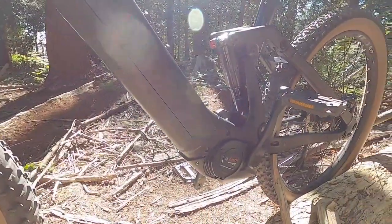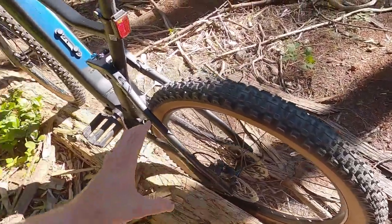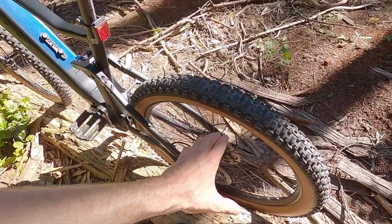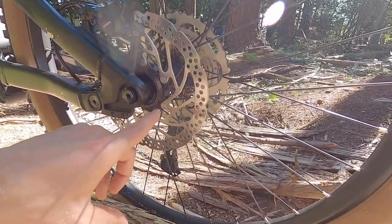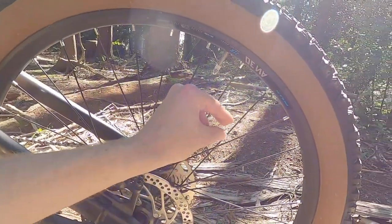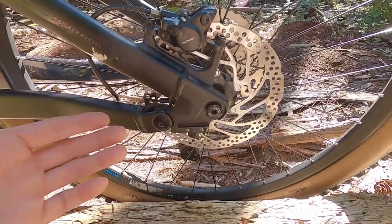The motor works really well. It does produce a bit more noise and drains the battery a bit faster, but you have a super high-capacity battery pack. The motor measures rear wheel speed, pedal cadence, and pedal torque over a thousand times per second — super dynamic. It even has shift detection, listening for pressure changes and easing off a little so you're not stressing the chain or bending the sprocket teeth. The rear wheel speed sensor magnet is built into the disc brake rotor mount, which is much nicer than a spoke magnet that can get bumped out of position and cause read errors.